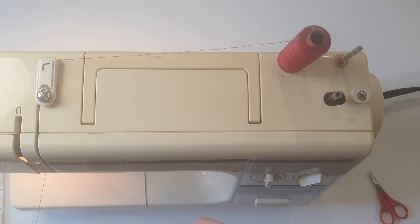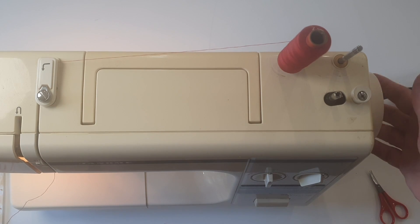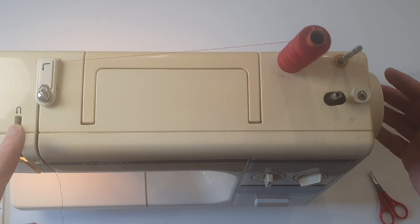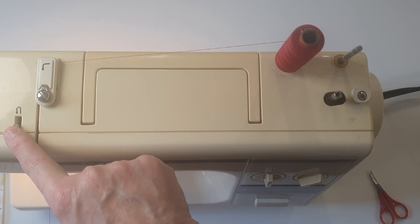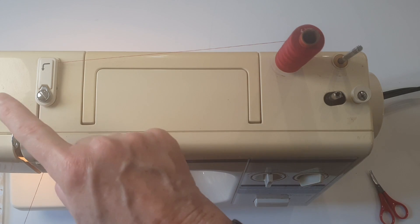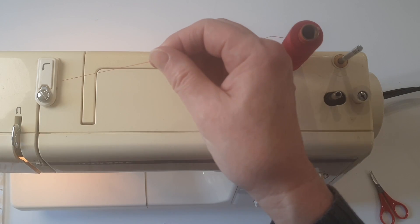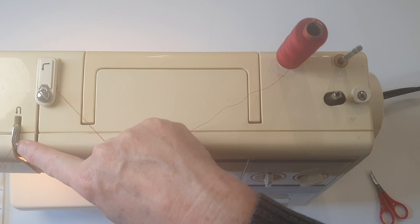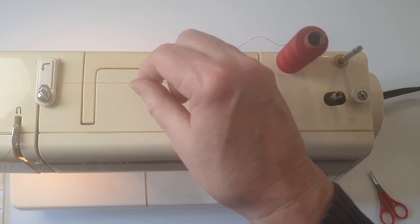It needs to connect over here, and to do that I'm going to push the piece in on the flywheel and now I can turn this until I get the take-up lever to the top. The take-up lever being at the top is really super important — it means the machine has finished its stitch. So I'm holding this, going in there and around, and it's now caught. When the take-up lever was down I couldn't get it to catch.